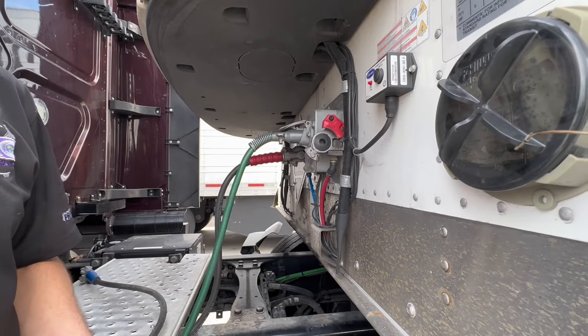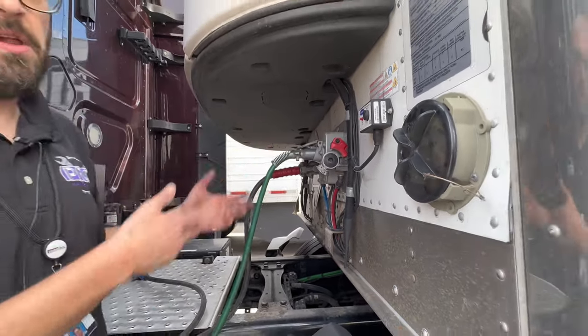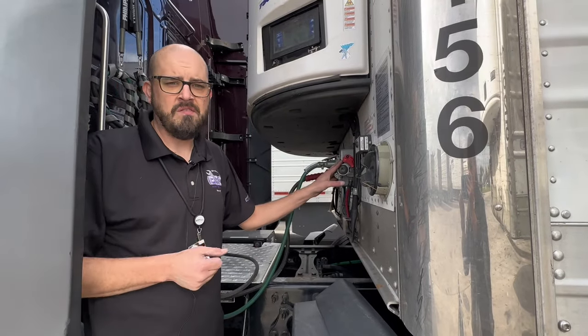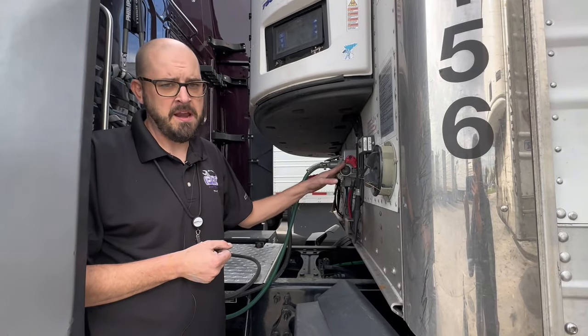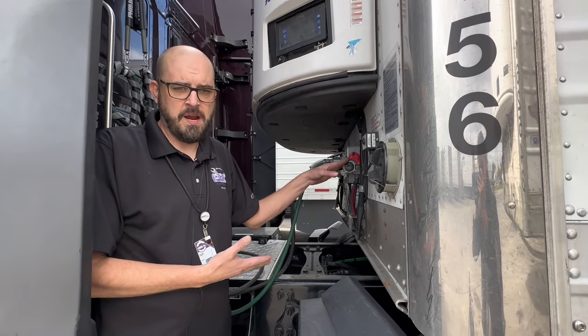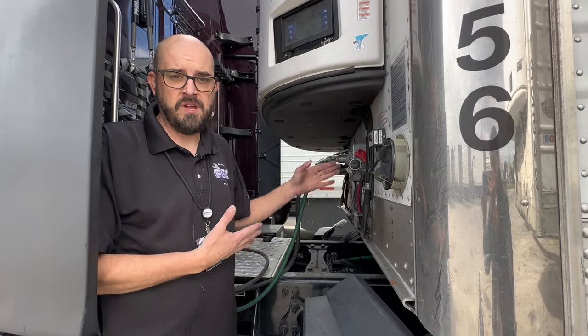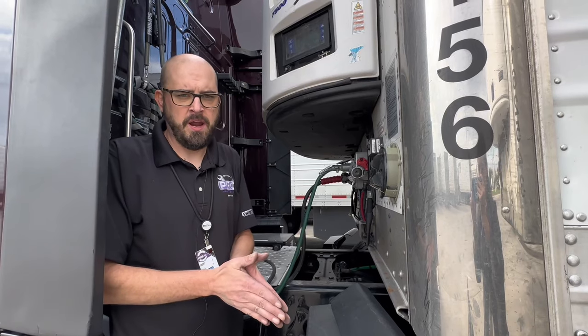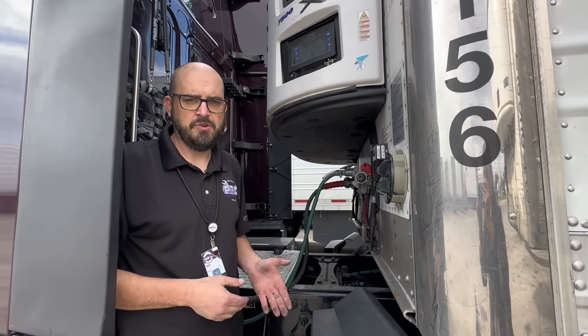You're going to release air into the trailer. Typically when you've got these airlines hooked up correctly and you press in that red valve on the dash, you've got air going into this side — supplying your spring brake chambers, your emergency chambers, with air pressure to release those chambers. That's how that normally works; it supplies air into that chamber to compress that spring and pull your brakes off the drums or the discs.